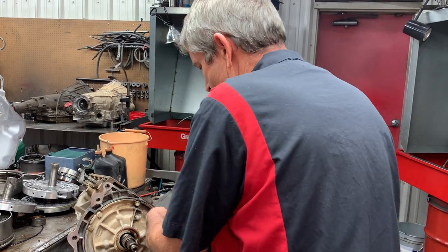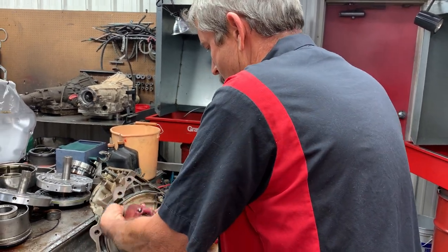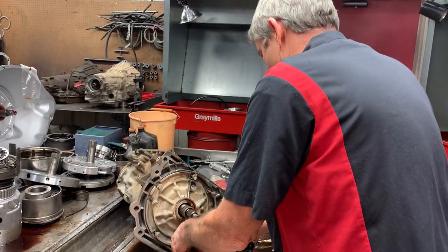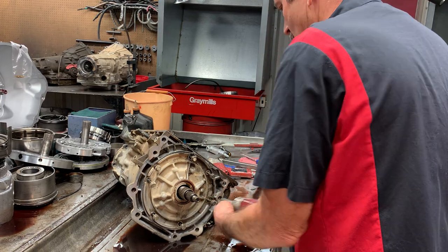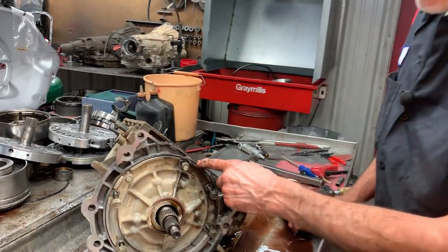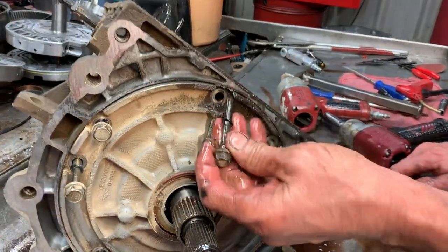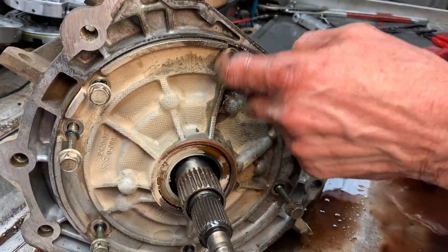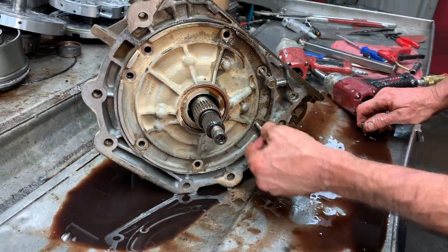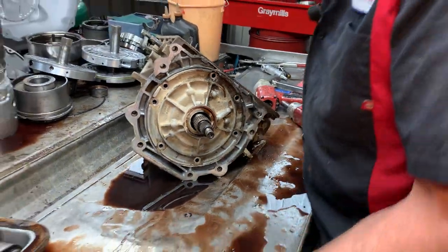There's a flywheel. There's a lot of fluid around these bolts here - that's why I tell you, even though you change this O-ring right here and put a gasket on it, always put some silicone around there. Because if it's not sealed, you take a big chance of that bolt leaking.